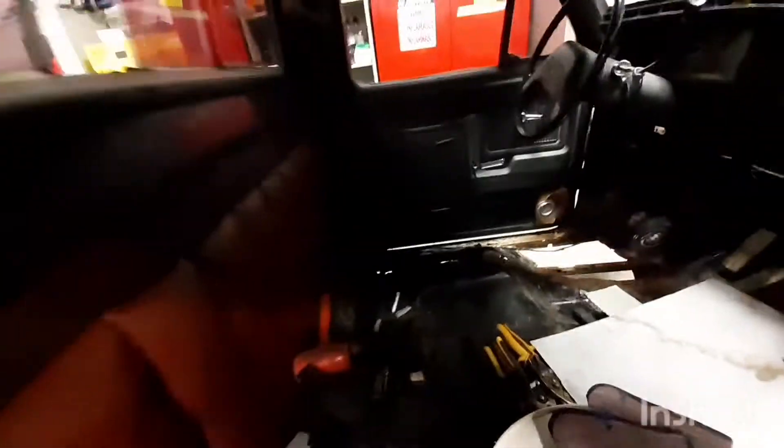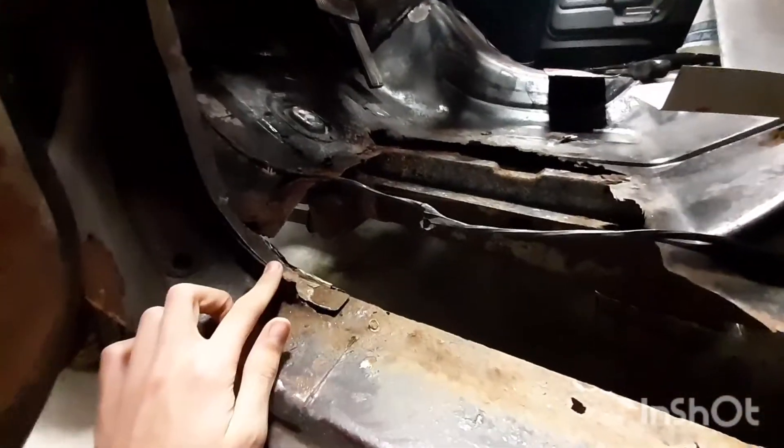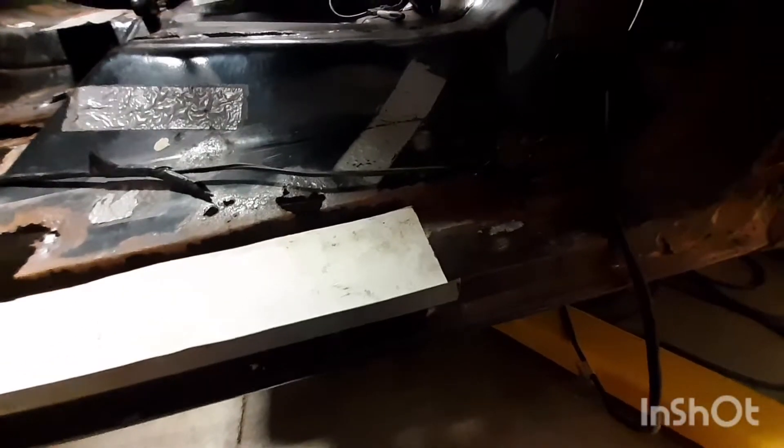Anyway, let's get into the part where the floor comes in. This is the piece that goes on to the floor right there. This cross member piece here — if you look at the crease of the door, it bends up. I had to do some research. This crease here bends all the way down where it's all rotted out and goes up into the door. I bent this piece with a hammer, believe it or not, and it turned out pretty good.